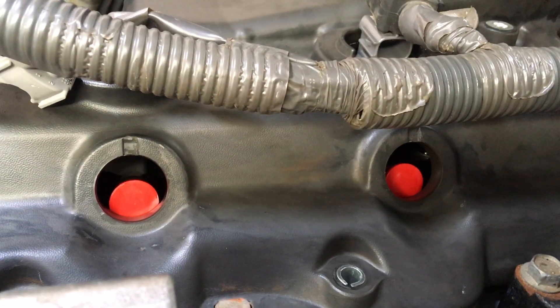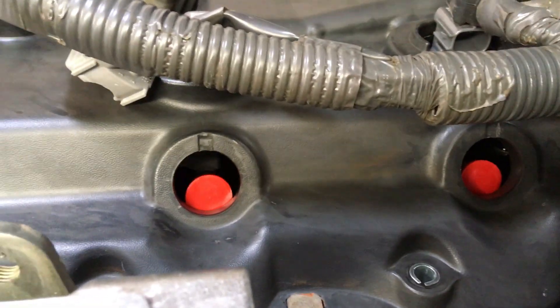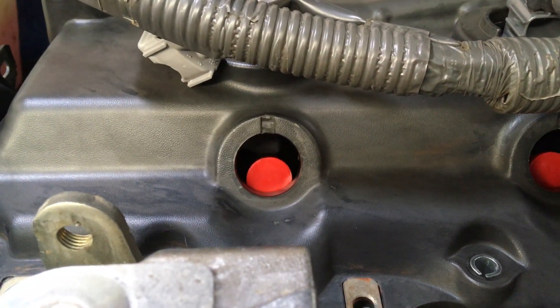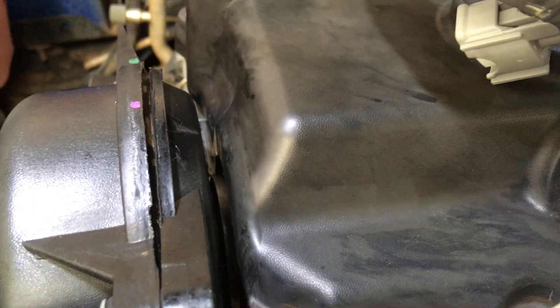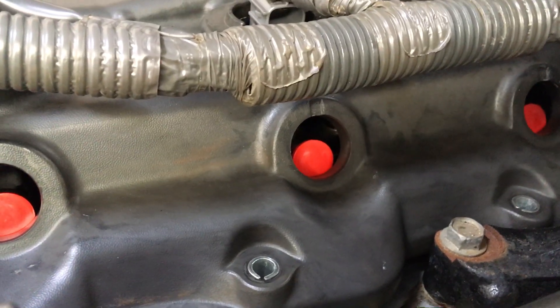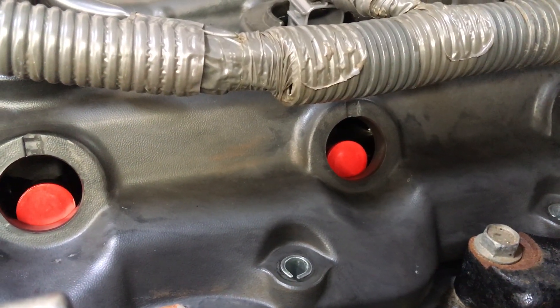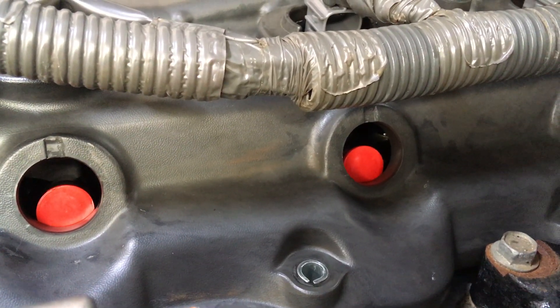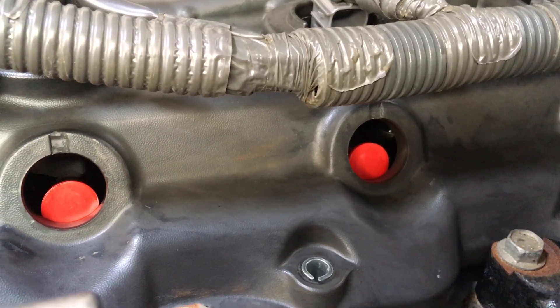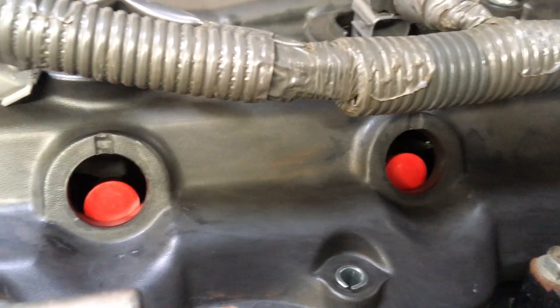Make sure it's aligned like this, gently take the cover back off, and then you can torque it all down to spec. Triple check your work, make sure it's all done right, and then you can finally put the cover on once and for all. You don't need to cover the whole gasket in silicone — it's just four prescribed dobs at the front, each side of that hump and each side of the half moon at the other side. Four little dobs is all you need. I drop those nozzle holder seals in place so nothing falls into the injectors, then put the silicone on the head at those four places and put the cover on once and for all — obviously after torquing everything to spec. Don't forget that or you'll have a massive fuel leak in the engine. Happy days, alright guys, hopefully that's helped. See ya.